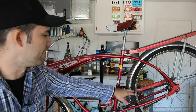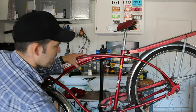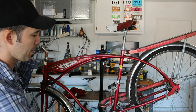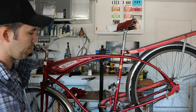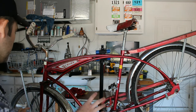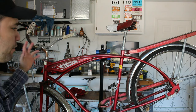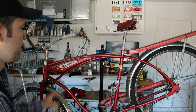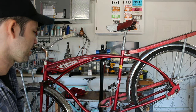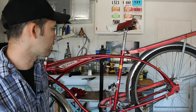Obviously it's going to need new tires. The hub — something's wrong with that. There's tons of play; according to the prior owner it will pedal and stop, but there's about half a pedal stroke of play, so something's wrong in the hub. I think we're missing a spoke back there too. Definitely the wheels and hubs are going to need some work, but other than that it should work. It doesn't have a front brake, so that keeps it really simple. The rust isn't too bad — there is a spot with some surface rust where the paint is worn out completely.